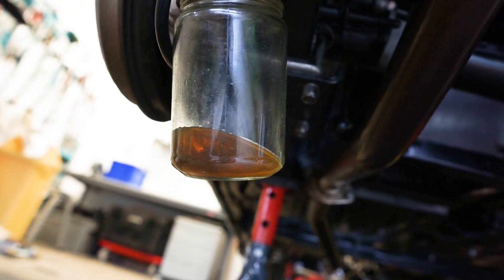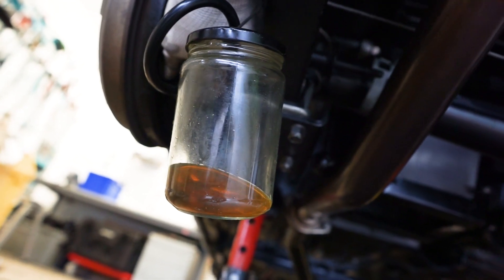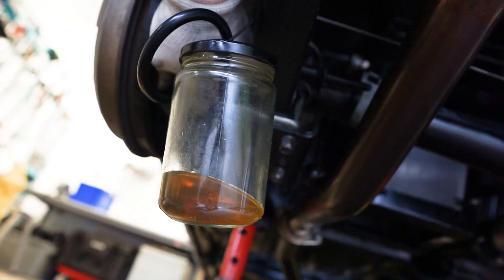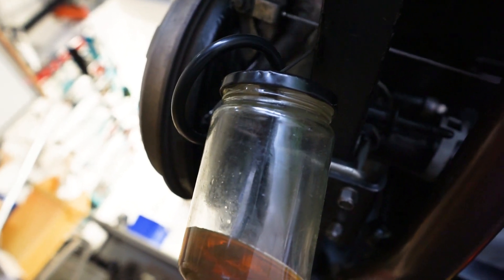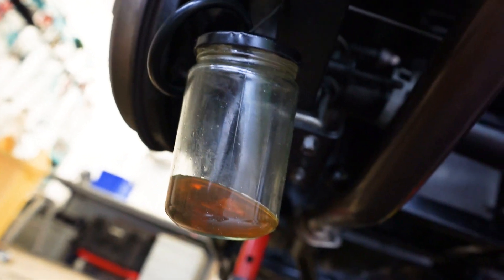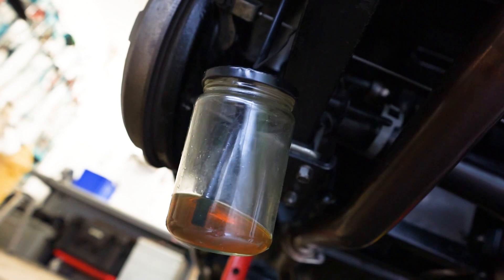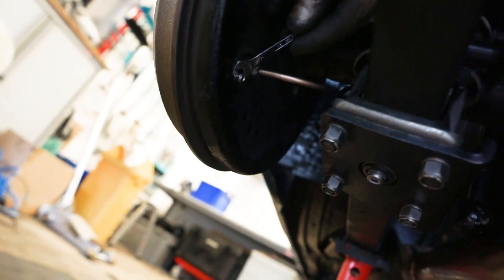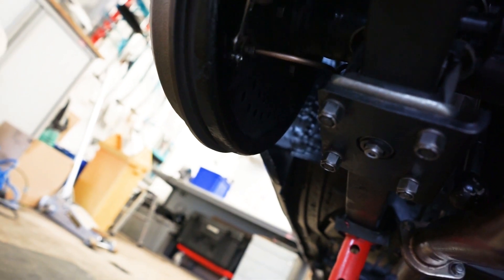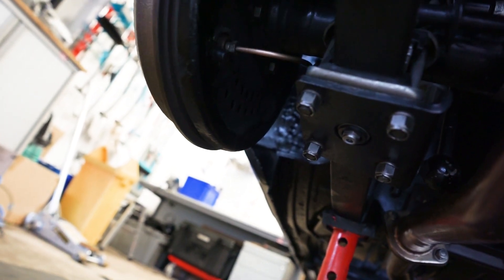I'll close it off finger tight and open it up again just to check for any air coming through — I'm not seeing any bubbles, which means this corner is bled properly. If you are seeing bubbles once you've closed that off it could mean you've got a problem with your master cylinder, but no bubbles means you've got the air out of the system on this side. Just lightly pinch those up — you don't need to do them up too tight. When you disconnect, hold the hose up so the fluid drops back into the pot. Be very careful not to let the fluid squirt around. I'll tighten it up with just the end of the spanner and put the bleed nipple cap back on.